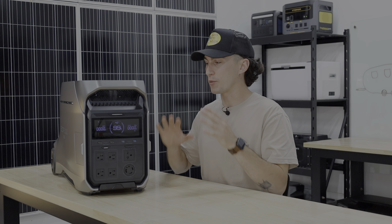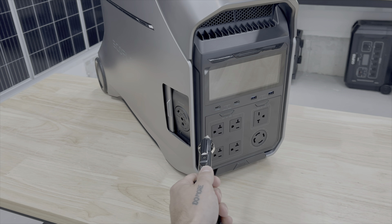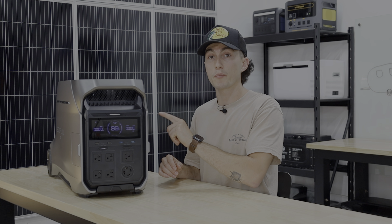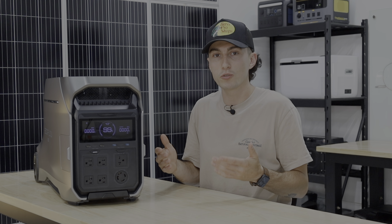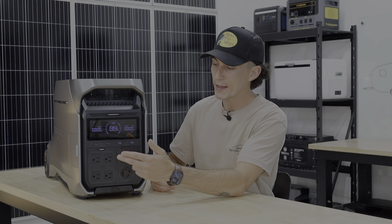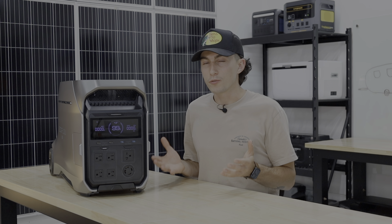When we talk about things I don't like, starting with: there is no 12-volt car socket on this unit. That may not seem like a big deal, but I just got back from a camping trip using a Delta Pro with my fridge plugged into the 12-volt socket on the side — because it's DC, it doesn't have to use as much power converting to AC. Many camping and trailer appliances run 12 volts. Without the car socket, you'll have to run them on AC, which means routing power through the inverter and losing efficiency. They give us a barrel connector instead — a 5-amp barrel connector that barely anyone uses.